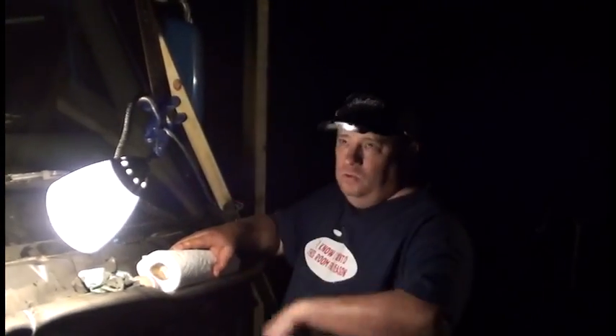A lot of guys will use a little bit of ether, but I like to use really cheap brake cleaner, because really cheap brake cleaner is nothing but acetone and methanol. I spray it into the intake pipe while somebody's turning the key - give it a little help. I don't like to use ether because it's so explosive - you can get a really bad backfire with ether. You're still going to get a little bit of backfire with acetone methanol spraying in the intake, but with ether it could be really strong. I like to be a little safe - something a little less volatile. Cycle that electric pump six times rather than just cranking and wearing the starter out.